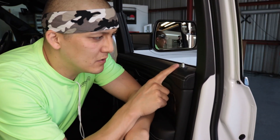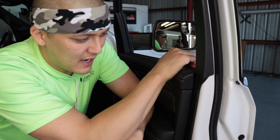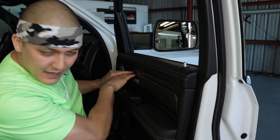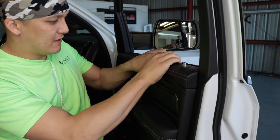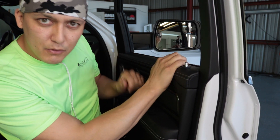With the front door, all you're going to have to do is grab the top portion of the panel and just pop the top back enough. It's still connected here and here at the door handle, so you're just going to pull back just enough so it pops the little clips and then you'll be able to pull it out.